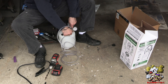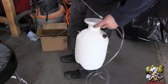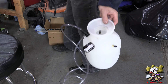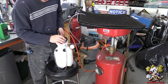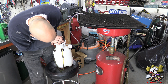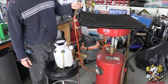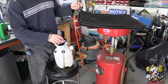So if that happens to you, you can do the same thing. And now that's tight. Use some compressed air in here and also blow through the tube. I'm also going to put some oil through it first for the system just to clean anything that may be in there. Alright, we put some water oil in there just to run it through the system, make sure everything is nice and clean. Now we're going to blow some compressed air in here — about 15 PSI — and it looks like it's working nicely. This is just to clean everything out, make sure there's no debris.